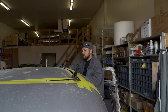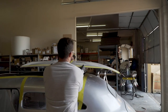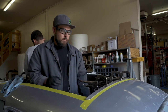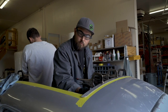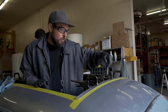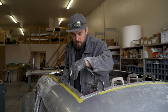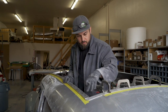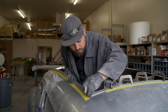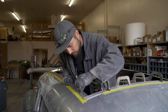We connected the dots with the blade and it's time to get her off. We dropped the frame in, double-checked to make sure it fit, took it apart, put the rear frame and front frame in, and mark all your holes that you're going to drill through the sheet metal of the car. Once we got the front and rear frames marked in place, it's as simple as getting your side frames lined up with the edge and marking all those holes.